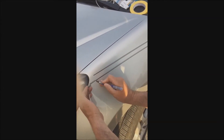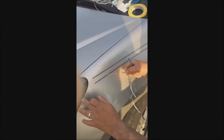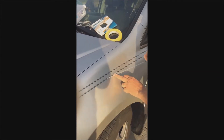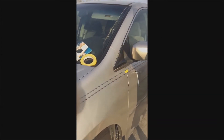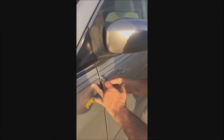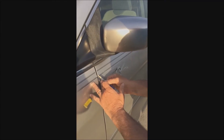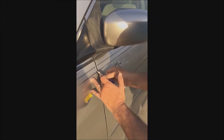Now to finish it, I'm going to go back and cut the bottom line again, then tease the backing off and pull it all the way back. This is how we trim the doors — we usually come back about an eighth of an inch. Now there's a couple of ways to do this: you can just click each one gently, or you can roll the blade like so. I do them both.